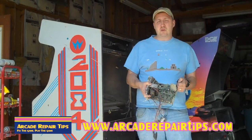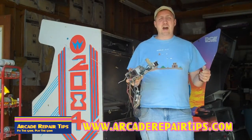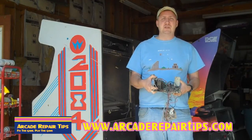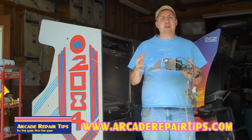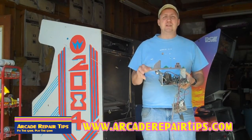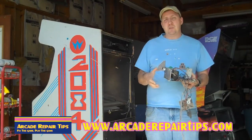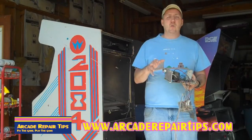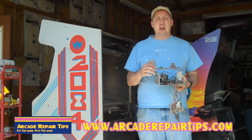The horizontal width coil controls the horizontal width, or the size horizontally. A lot of you guys have emailed in with questions and said my picture is kind of shrunk in on the sides, or maybe it's too big. Well, this could be one area that you need to check, and this is not on your potentiometers that you see. A lot of people ask why doesn't it say where to adjust this — today we're going to show you where to adjust this and how to do it properly.